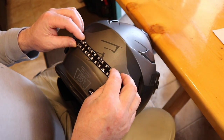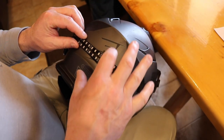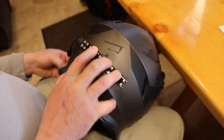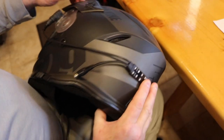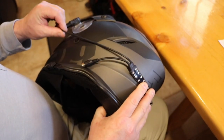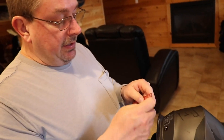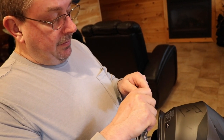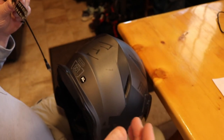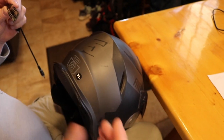I like to keep the light somewhere in the lower midsection of the back of the helmet. I'm going to hold it in place and make sure that when I close the heated shield and open it, it's not too tight and it's not going to pull this apart. Once you've figured out where you're going to mount the light on the helmet, you're going to remove the release liner on the 3M adhesive. If you stick it on and don't quite like where it is, you can pull it off quickly before the glue has time to set up and activate.